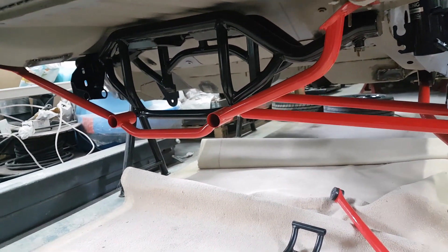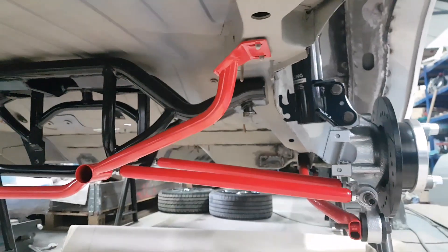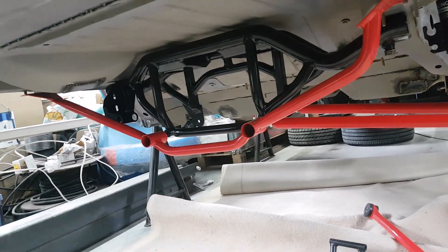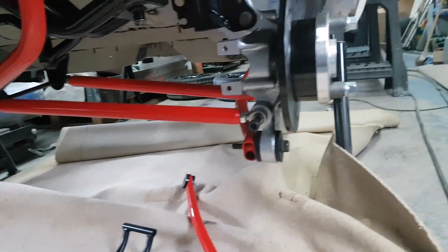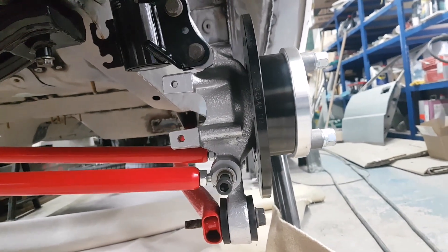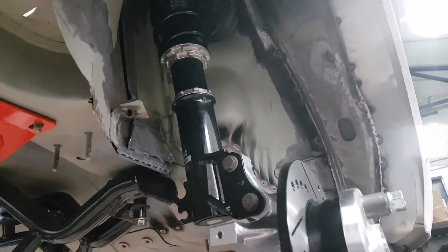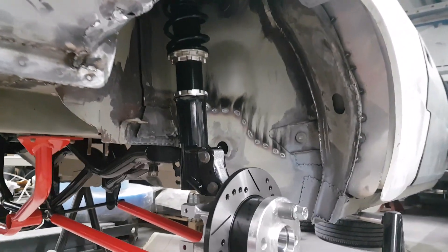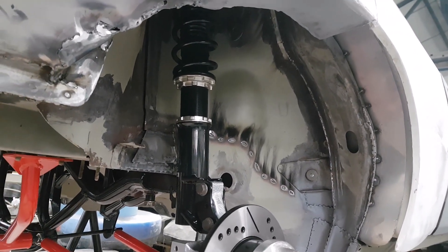The diff cradle from Walkers, the red brace that runs across goes up to the mounting for the anti-roll bar — so there's an extra bit of bracing on there, that's an OMP item. Then you've got the two suspension arms I've made up, original powder coated silver hub carrier with all new bearings in it ready to rock, and then we've got the BC coilover coming down from that. Bear in mind that because I'm doing this for hill climb I've got free regulation on there.